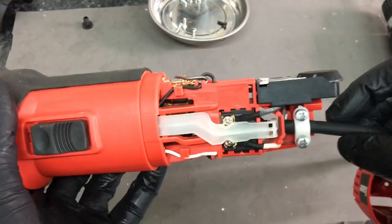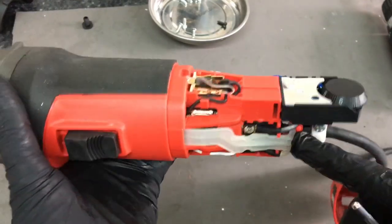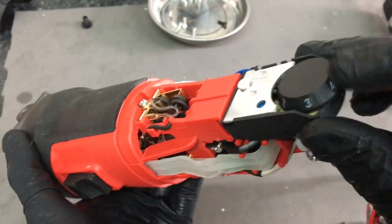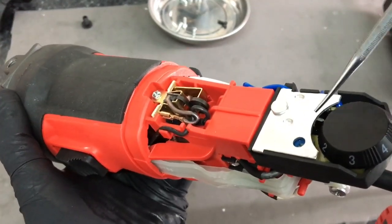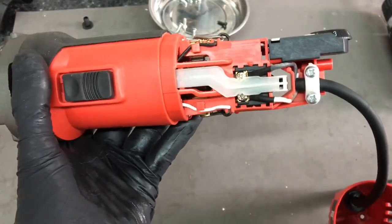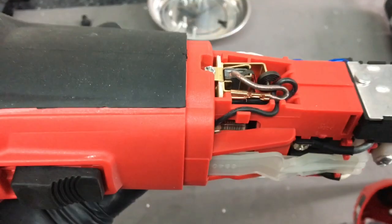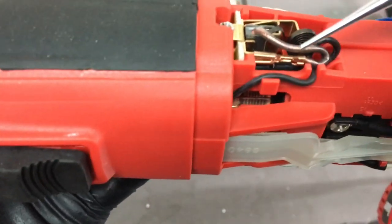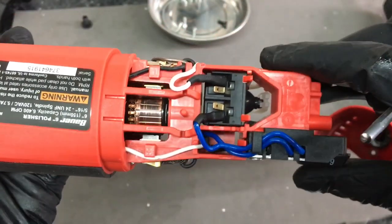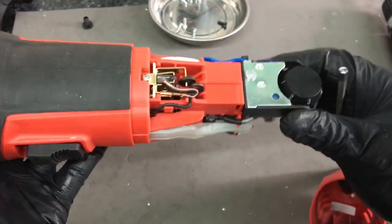While we're down at this end of the polisher, let's take a look at the inside. This is the nylon arm that comes down to the 8-amp switch that turns the unit on. This is the speed dial — again, I'm not very satisfied with the dial not having any tactile feedback whatsoever. Also, the old Chicago Electric unit had a coated PCB board and this one does not. Coated PCBs protect it from moisture and dust, and that just makes me feel a whole lot better. The only other thing I don't like: the crimp spade connectors don't have shrink wrap on them — that's a little sloppy. Here they did put some shrink wrap, they just didn't put it everywhere. Everything else is standard in here.